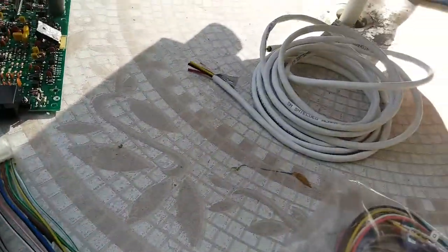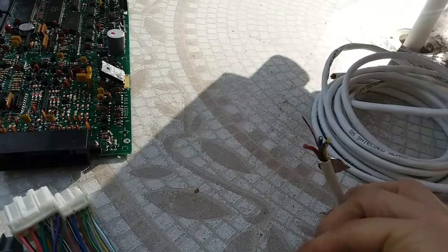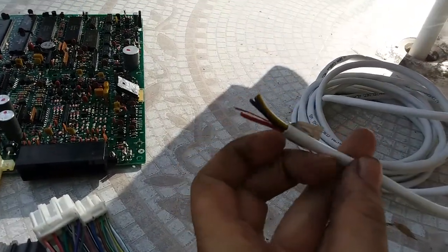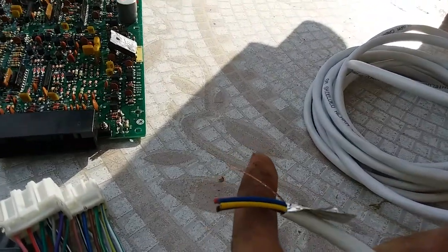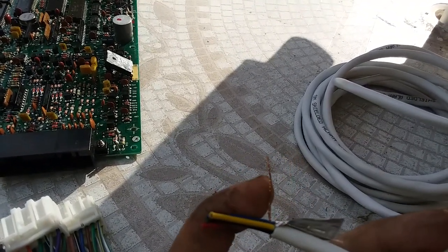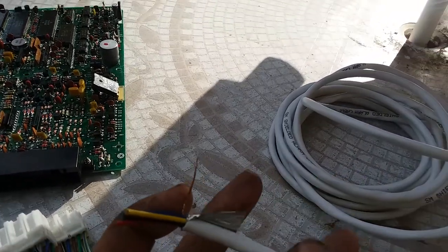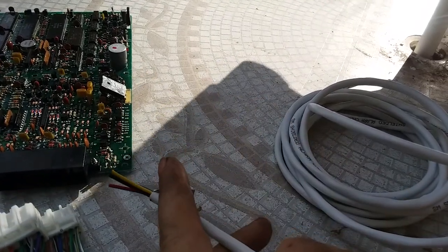When you're running your wire for your distributor, I use a shielded wire — I usually use a 4-conductor shielded wire. I'm mainly just going to be using 3 wires. The three connections are A21, B15, and B16. This little bare wire needs to go to B2 to ground your shielded wire. Your shielded wire only gets grounded on one end, right here at B2.